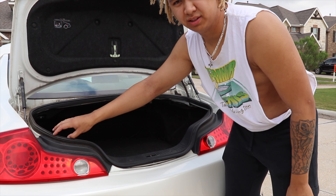Alright, so here we've got the wires exposed now. You've got to cut this part a little bit so you can expose more wire. Essentially our module is just red and black. For the black, of course it goes with the black. But for the red one, it does not go with the red — it goes with the green with the yellow stripe on it. The green with the yellow stripe is going to be that one. So make sure you guys don't get that confused — don't put it with the red, put it with the green with the yellow stripe.